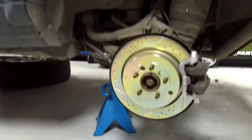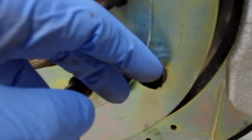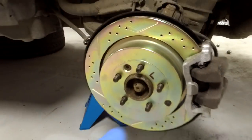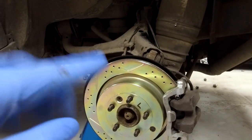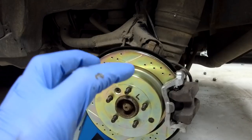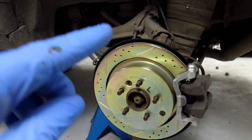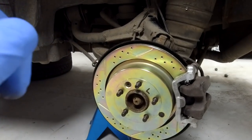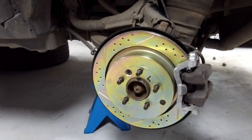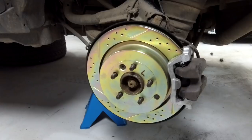Basically your adjusters are accessed through this little plastic cover that you've got to flip off, and you've got to get your torch out and have a look. So I'll whip these both off, show you where the adjusters are, then I'll put the shoes back on, the discs back on, and show you what we've got to do. The next video after this is a bedding video. There's some witchcraft you can do in the car, and you've got to drive it at a certain speed, but we'll do that in the next video.